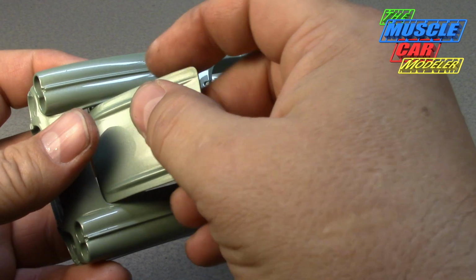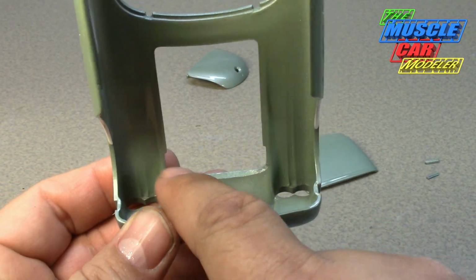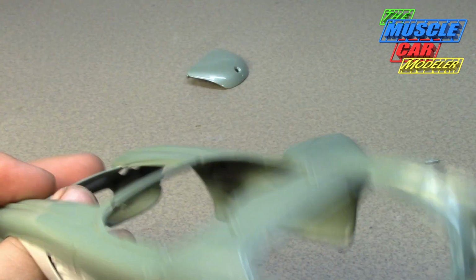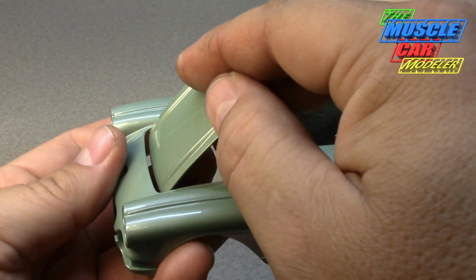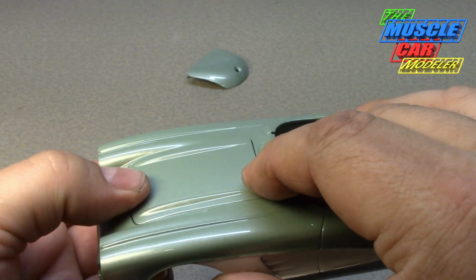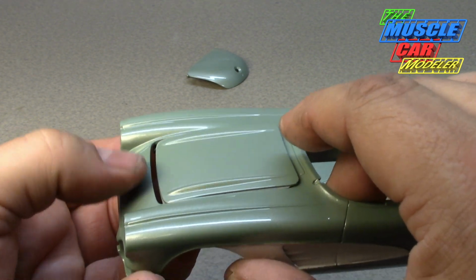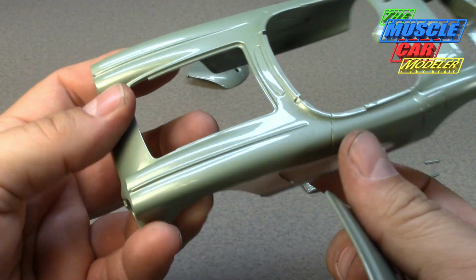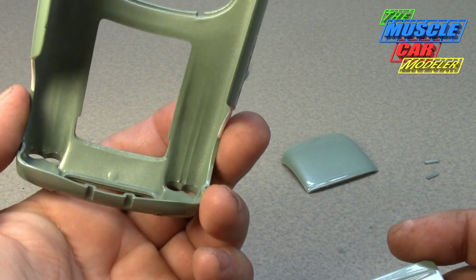And one of the things I forgot to do was on the inside here, you can see I had trimmed and shaved it. Well, this comes at a much sharper angle, and part of the problem with this hood is that when you're opening and closing it, the front dips down. Well, it was hitting, so it didn't quite close right. It was also pushing it back and pushing it into here. So I increased the gap here, but I was still getting some interference here. So I cleaned all that up, reshaped that, and got that clearanced out, and now it fits really good.